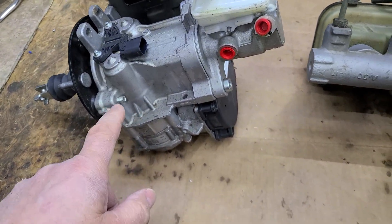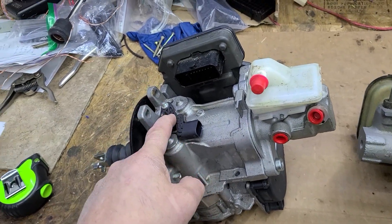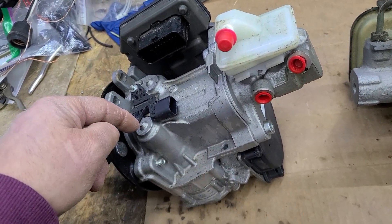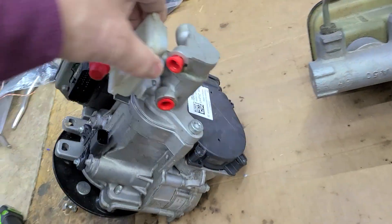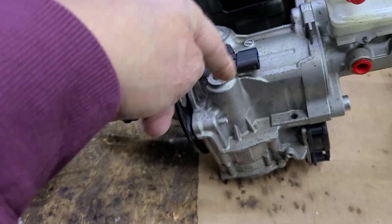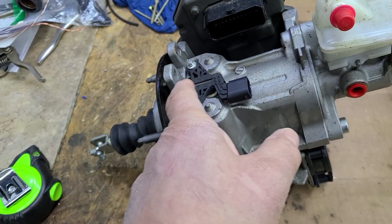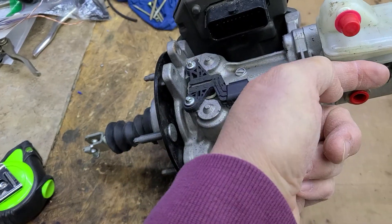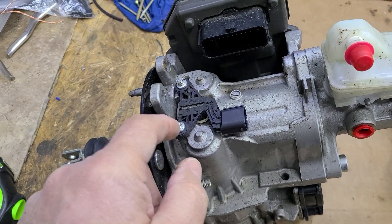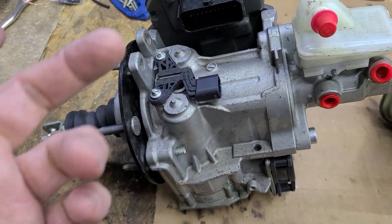This is self-contained. It works very, very well. It works the same way as drive-by-wire — similar type deal where you have a throttle position sensor, or in this case a piston position sensor. Inside of here there is a worm drive. There's a motor inside which turns a worm, which has a round gear, and it basically turns like this. There are a couple of springs inside of it — a small light spring on one side and a very large spring on the other side. Essentially, it just takes a little bit of a signal and drives a big motor to give you much more torque.